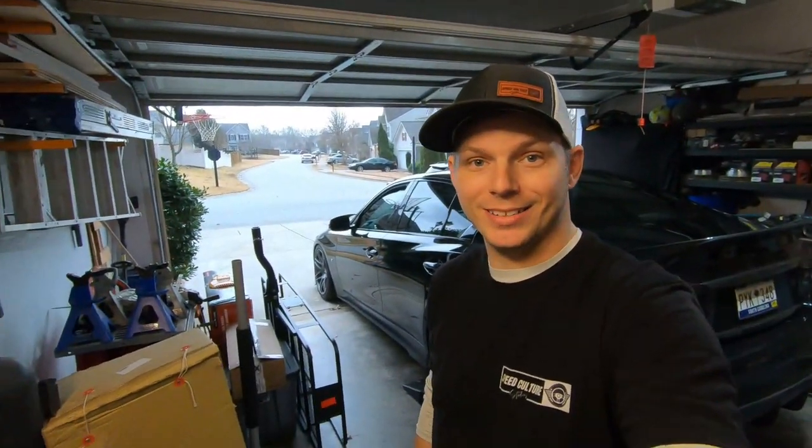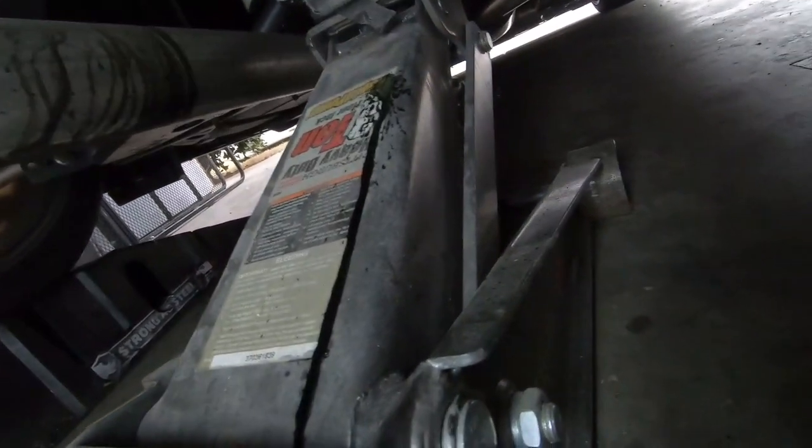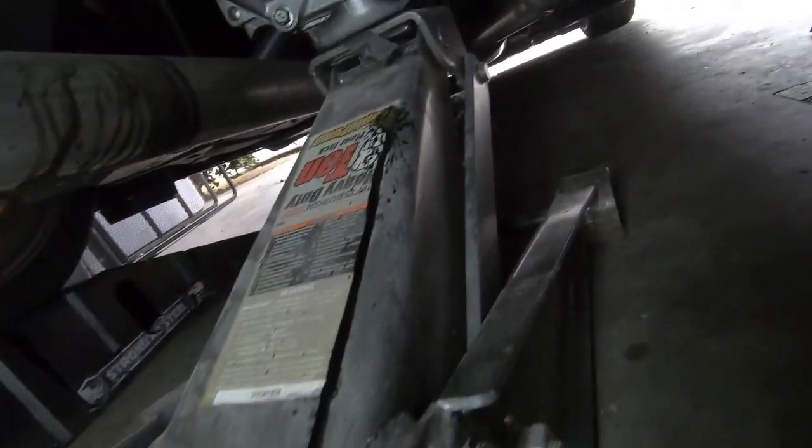I just talked about this part being a common failure point in Nissan Infiniti cars, particularly in the G's, Z's, and now the Q50s. A lot of people have been asking what they need to do to remedy this issue because they're finally experiencing it in their Q50s, and there really isn't a good remedy. I got underneath the car and what do you know — I see the black greasy slimy residue coming down the rear diff, telltale sign of a failed rear differential bushing.